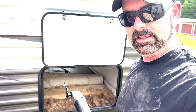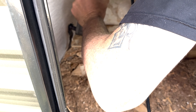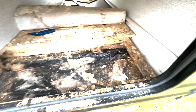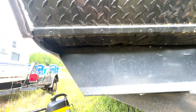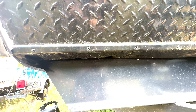I used the oscillating saw to get a couple of small pieces out on the corners. After pulling out the insulation you can see the wood framing and then just the plastic underneath that keeps moisture out. The plastic sits right up under the edge at the front, which isn't ideal. Down the road it might be worth pulling those screws and adding a metal deflector to keep moisture from getting up while driving. We hit the area with a shop vac to get it cleaned up before putting everything back together.